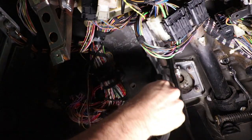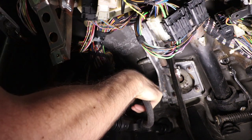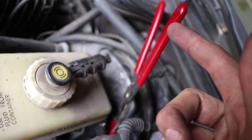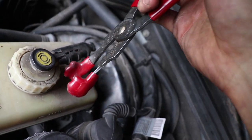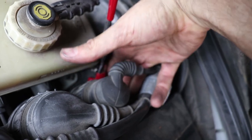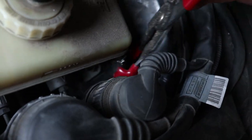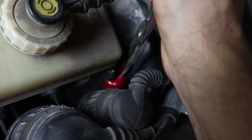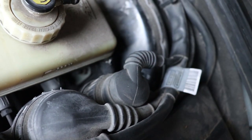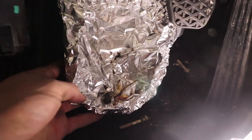Run this hose back up through the area — we're just going to have to do this by feel. To get this back on I used spark plug boot pullers; they work really well for this. To get the hose out you have to really reach in there and try hard — it's a pain in the neck. But with these pliers I was able to reach down there, grab it, even grab the hose itself, hook it in, wiggle wiggle wiggle and pull up. It does it just fine and it ends up on there just like it was originally.